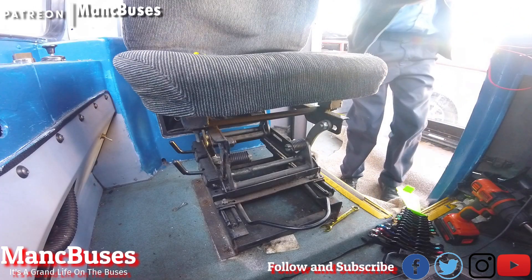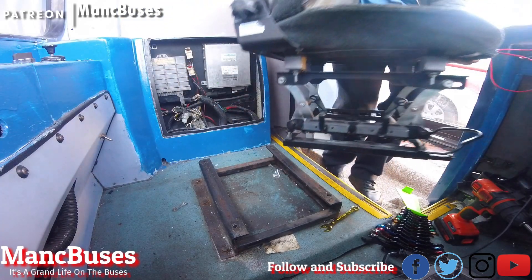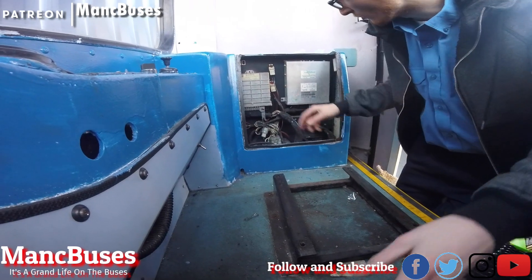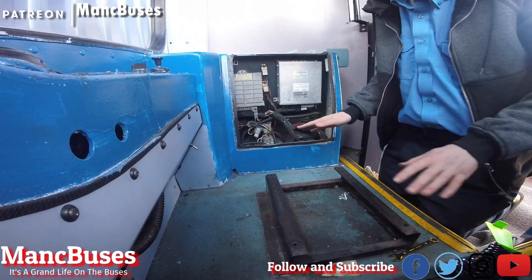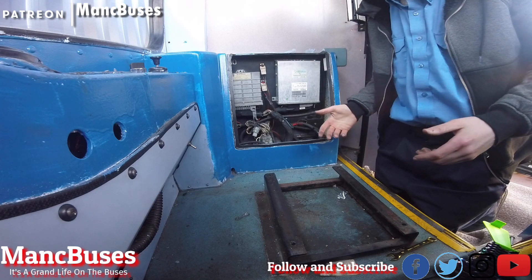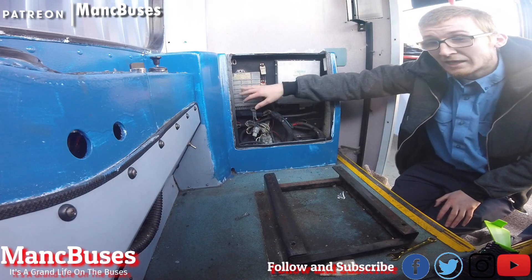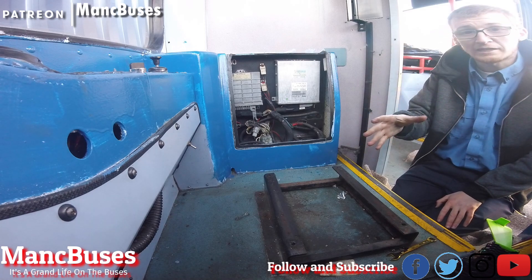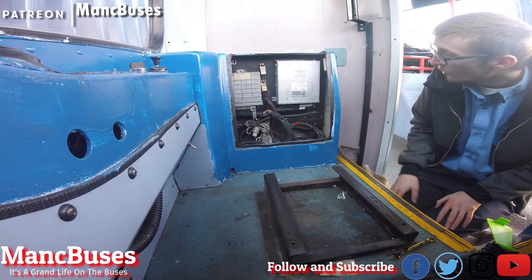Right, so that's all out — now in theory the seat should... yes, the seat is very heavy, very heavy. So this is the gearbox computer. I've worked out it has no power to it whatsoever — it is dead. We can tell that because when you try to start the bus in gear it won't start, so it knows the position of the gear selector. However, this also controls the retarder, and when you go from drive into neutral and try to start the bus, all the retarder relays click and fire up — they're not doing that. So this computer has no power to it at the moment.